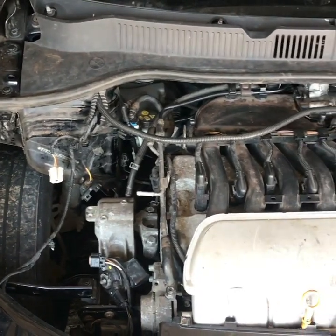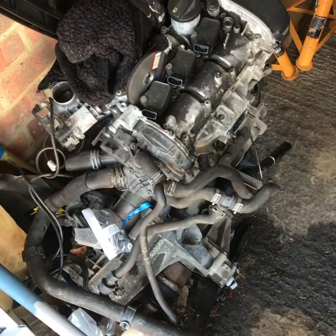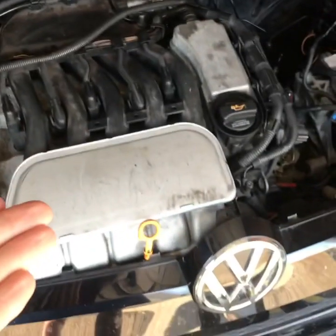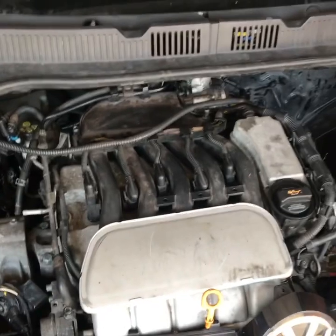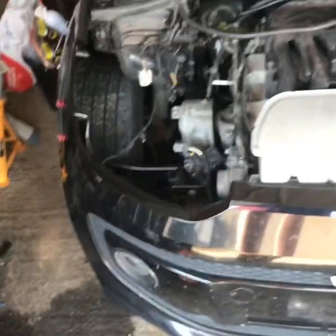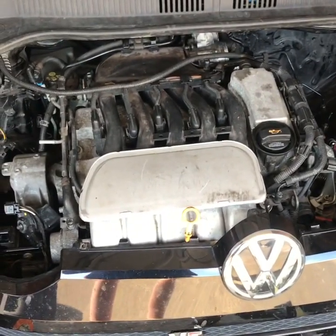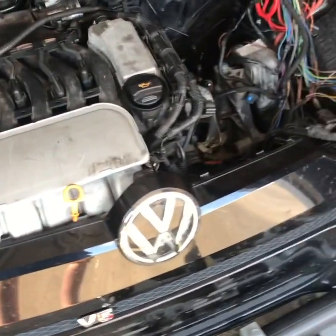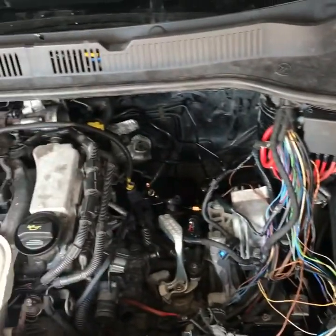As you can imagine, the springs themselves are only designed to hold this kind of engine, a little 1 litre 3-cylinder, and it has now got a 5-cylinder 2.3 litre engine. As you can tell, the weight difference is obviously what causes the car to be sitting as low as it is. Since I've had it jacked up on axle stands for the last 6 months, putting it down on the floor makes it seem like the lowest car I've ever seen in my entire life. It's really not, but it's fairly low.